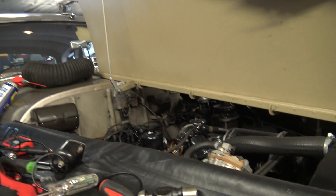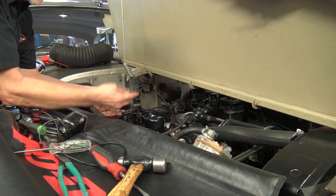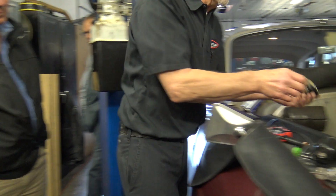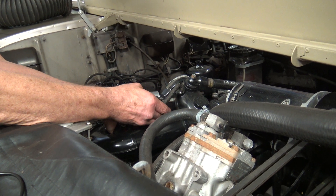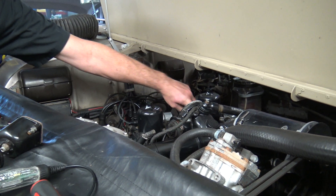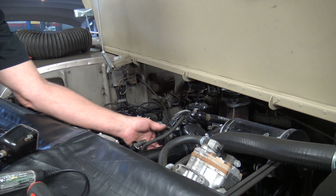So now what we do — now when I put this on, I want you guys to try to orient yourself here. You see this — this slot is at that angle. But if you look at this pan, it's at this angle. So what you've got to do is you've got to bias the spring as you put it on there so it matches up with that. So as I'm turning it, I'm trying to find that — there, it just engaged. Now you hear that? Totally different. It might be a little strong, to be honest with you now. I'll show you how you adjust it — I'm going to back it off two notches.